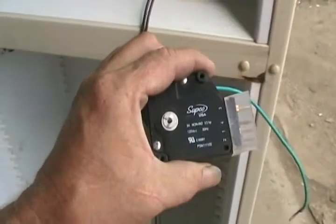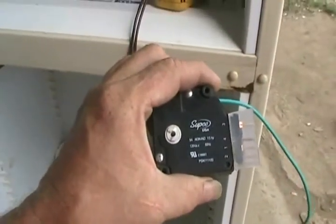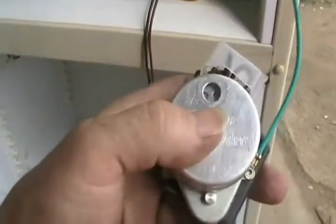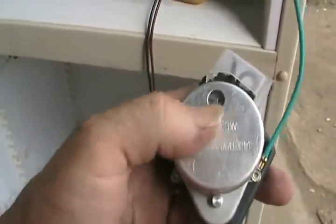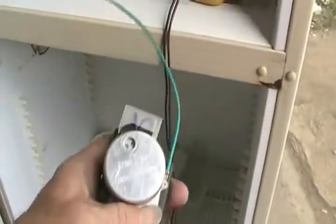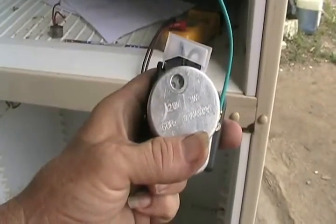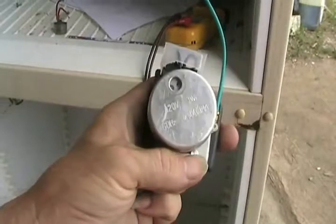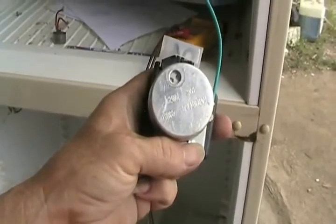It's not easy to test a timer with a meter because it's usually a mechanical problem. Very rarely the clock motor burns out; they usually just seize up. If they have this little window, you can see all those little holes rolling by while they're spinning. The confusing thing is, very often, just as soon as you find this thing and touch it and move it just to look at it or test it, you've shaken it enough that the little wheel starts turning again, and you may think the timer is good.